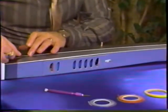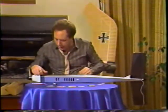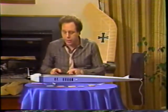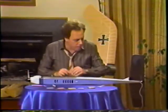And what we've really done is simply connected point A to point B with a straight pull. And as you let the tape settle down onto the fuselage, it's going to settle in a straight line. When the tape is down on the airplane, if you were to take your thumb and run it along the tape to tack it down, as you get somewhere between halfway and 2/3 of the way up the fuselage, the tape will begin to gather because you're going to be stretching it up on itself and puckering it and causing a buckle and a buildup of tape up here.